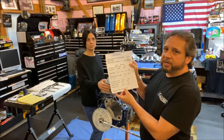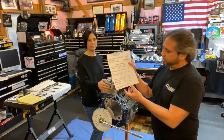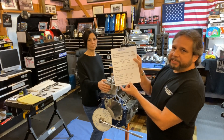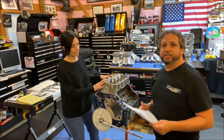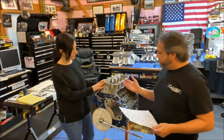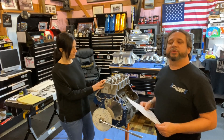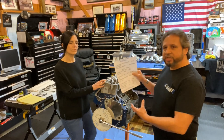In this case they want it advanced three degrees to 106. I can tell you right now this engine has been in at four degrees advanced since it was built back in 2013, and it's probably because when I checked it you can't get any closer unless you had a belt drive or a vernier drive to adjust it by one degree.